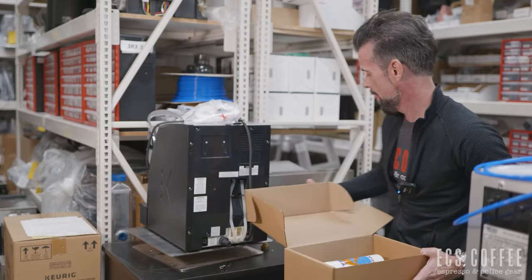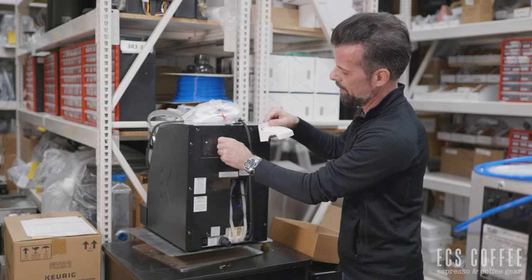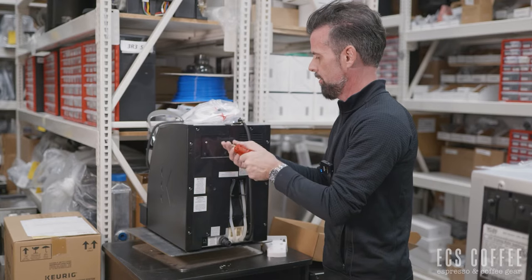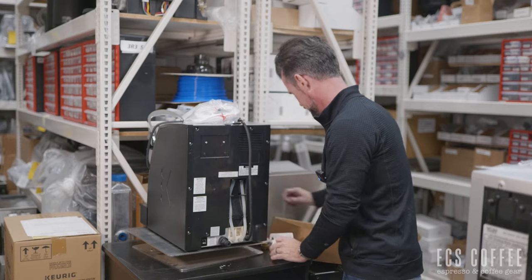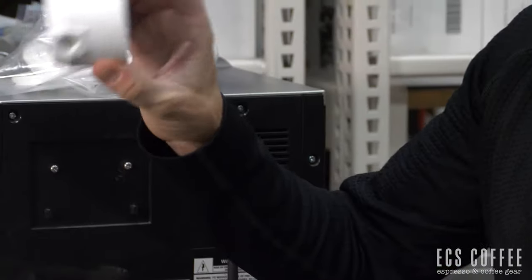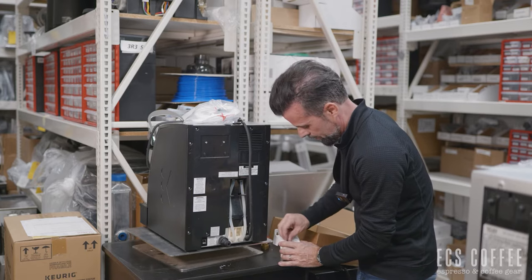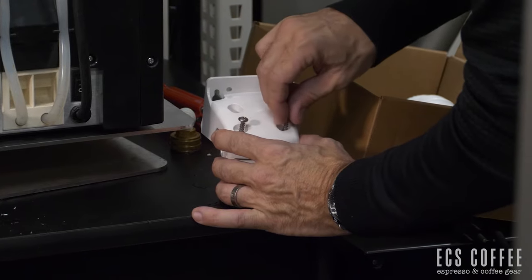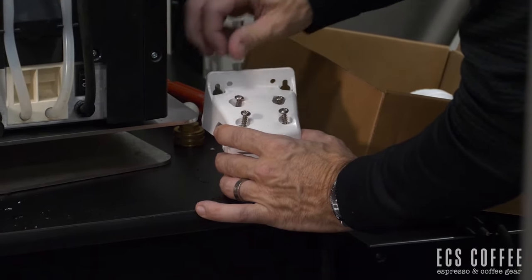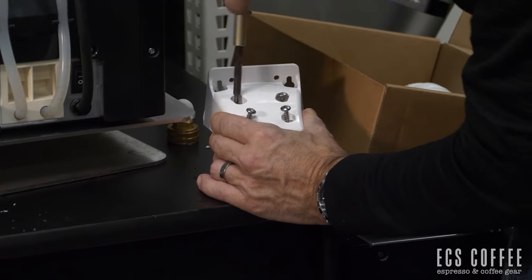What we have is a filter head, and on the back of the Keurig there are some screws — the bracket is just going to sit on here. I'm going to grab a Phillips and loosen those screws a little bit. Before we do that, I'm going to want to screw the filter onto the bracket first — makes your life easier. So this is the filter head and this is the bracket. We're going to do that with the four screws that come with it. Four holes line up and this puts your filter head onto the bracket — tighten that up as tight as you can.